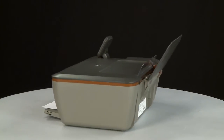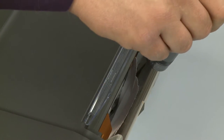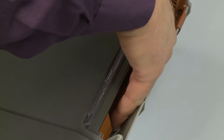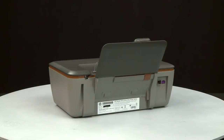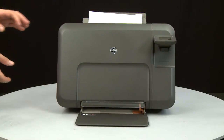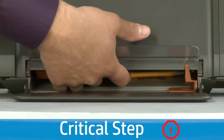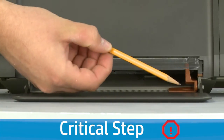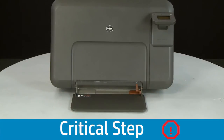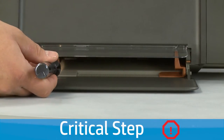Turn to the back. Use a flashlight to thoroughly check for torn pieces of paper and foreign objects that might remain inside the tray. If any debris remains inside the tray, more paper jams are likely to occur. Using both hands, gently turn the printer on its back with the output tray facing upward. Make sure the scanner lid is secure while rotating. Use your fingers to move the pick mechanism located inside the input tray and remove any debris. Use a flashlight to ensure there are no foreign objects remaining inside the input tray. Failure to remove debris could result in more jams or could damage the printer.